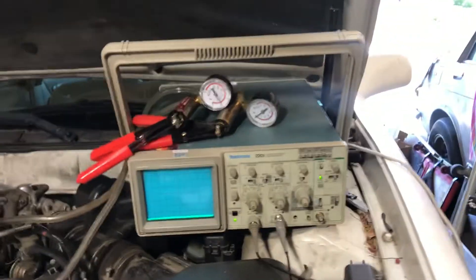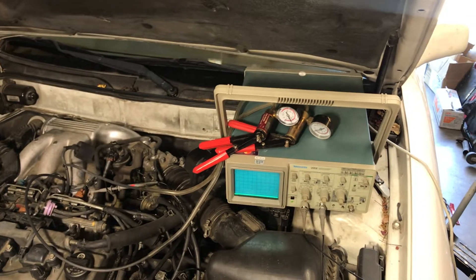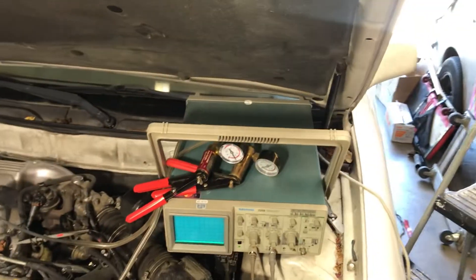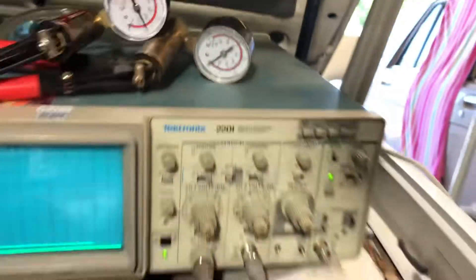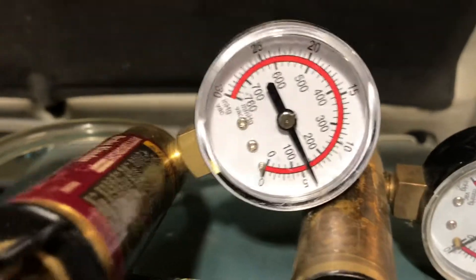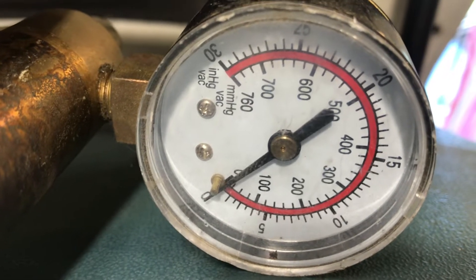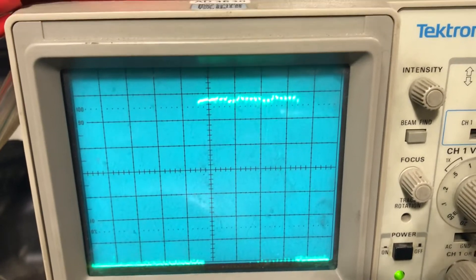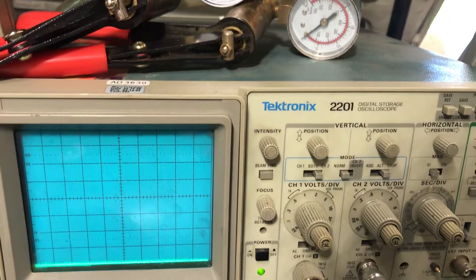You can see there is a relationship between throttle position, the vacuum after the PWM switching valve, and the voltage going into the PWM switching valve. You can see that the vacuum pressure going into the valve is pretty consistent at about six inches. The vacuum after the valve will start to tick up a little bit as I give throttle. So here's before the valve — pretty consistent — and after the valve. And here's the voltage going to the valve. You can see that the gauge after the valve and the voltage into the valve are related.